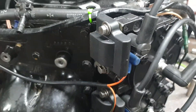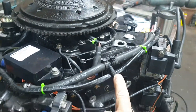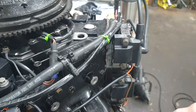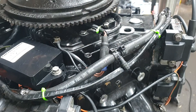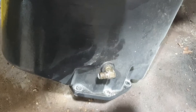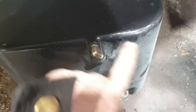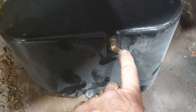I'm not telling you to take the head off right now. What I want you to do first is just check the exit ports. This is the back of the engine — this hose right here connects and goes to a box that sits right here. Here's the water box I'm talking about. That fitting right there goes to that hose up on the back of the motor. This fitting is notoriously plugged, so you've got to make sure this one is clear.